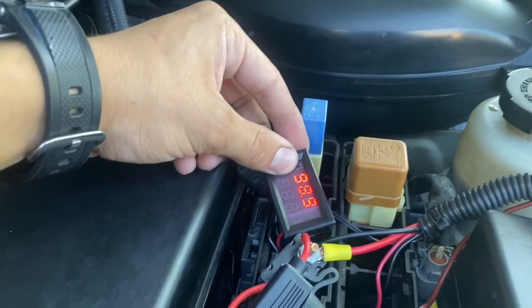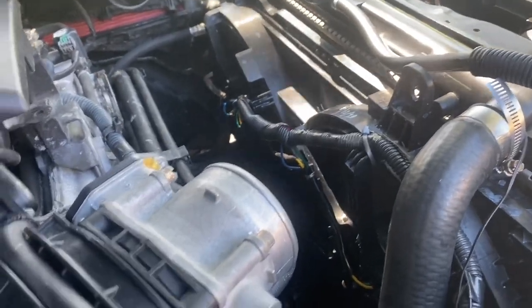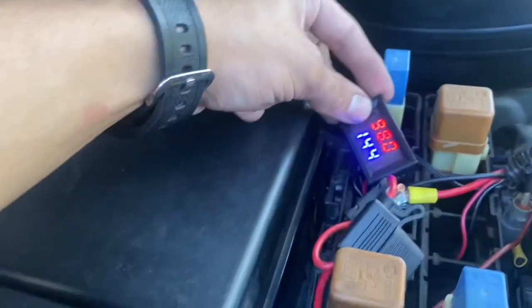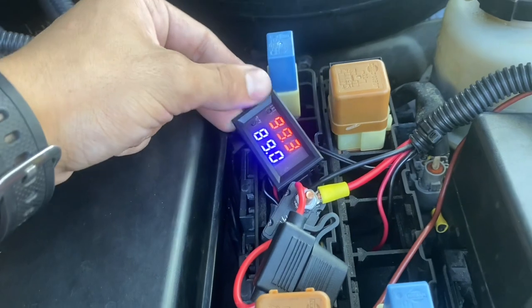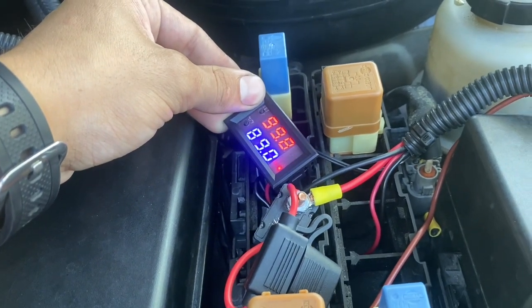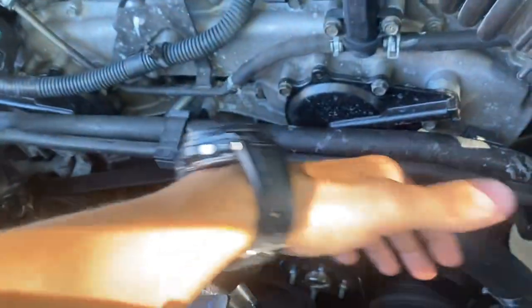The way Nissan designed their fans, it's four wires with an internal resistor built into the fan. To get high speed the way I wired it, the condenser fan has to be on also. Right now I'm going to command these fans on — turning this on will be medium speed, so I'll lower the temperature below the current 98 degrees and it should kick on. Takes about a second. Now both of these are on as well as the 10-inch fan. This is only medium speed and it already pulls so much air — these are crazy.